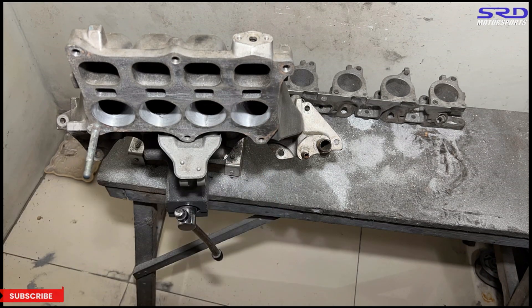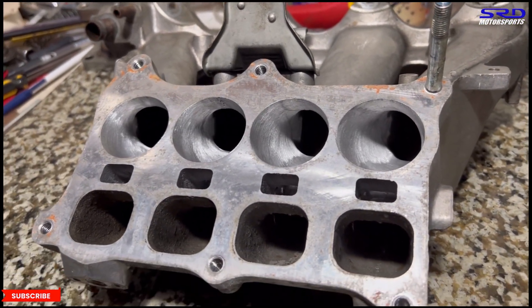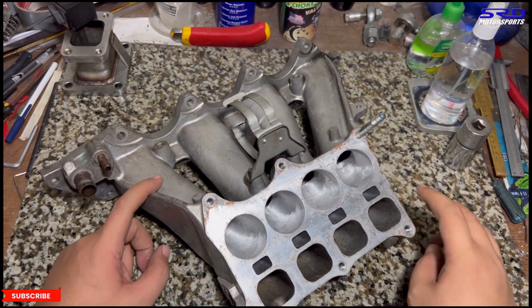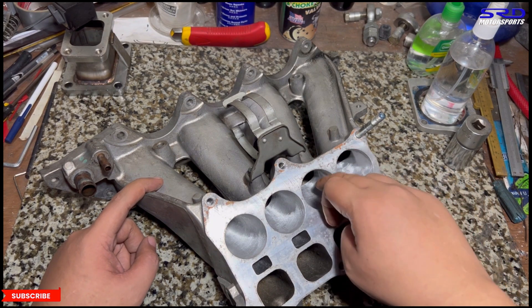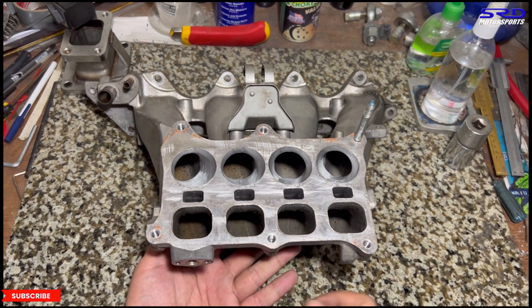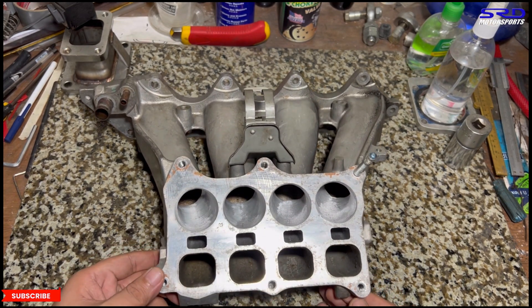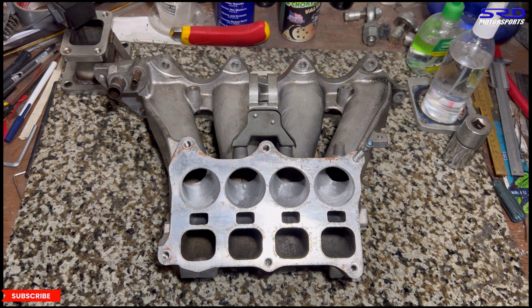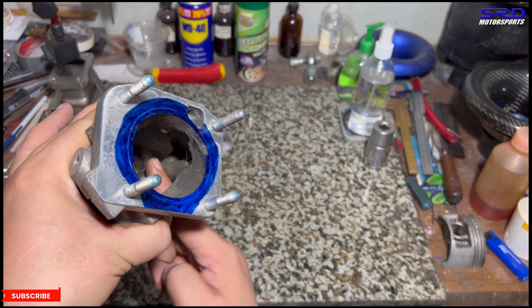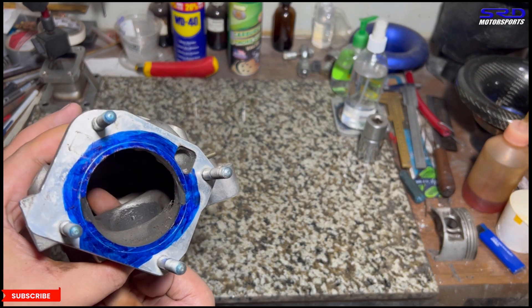Back at the workbench — it's getting there, not done yet. You can see we worked on the side walls and the short turn to make it good. It's gonna be flowing really well. Now before going back to the porting bench, let me show you — on the plenum side we're going to port this area to increase the opening, sort of to emulate a velocity stack entry. It won't be quite like a velocity stack, but it'll be close enough to improve the entry and get airspeed starting really early.